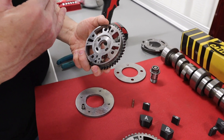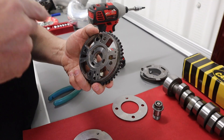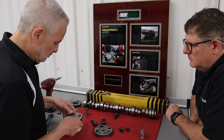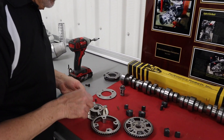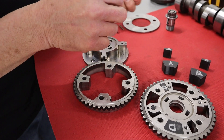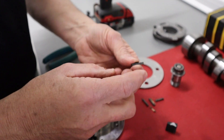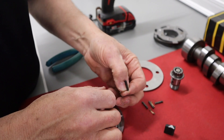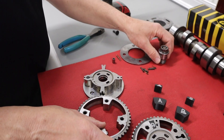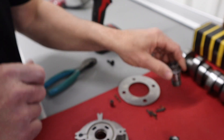It's not perfect, so when the engine's cranking, it can wiggle a little bit and advance and retard. That's why with some of our cams we have to limit the travel, because if it loses control during crank when there's no oil pressure, you can have pistons hit valves with some of the larger camshafts. So we take that out, and then we push this out, and all these little seals come out of the engine. This is a wedge or seal that goes to the outside of the unit, and this is a little spring that pushes it against the outside housing to seal the different cavities when you're advancing and retarding. The oil flows through the cavities to control the timing of the VCT unit — and that's what this valve does. You see two holes: if oil is flowing through one it's advancing, through the other it's retarding. That's how it adjusts cam timing in the running engine.